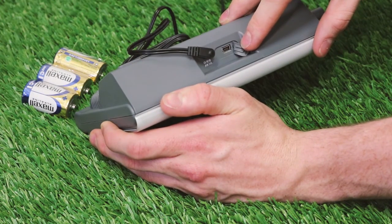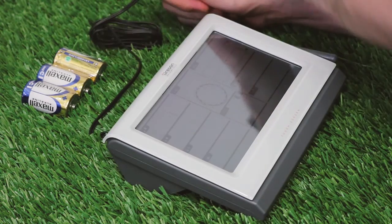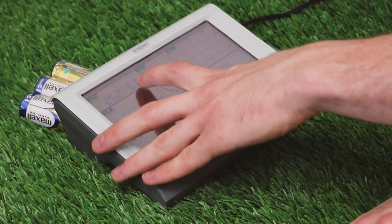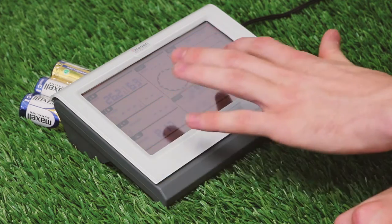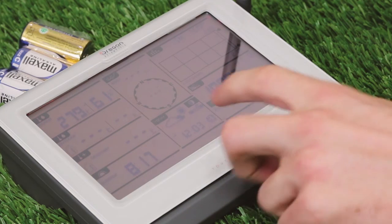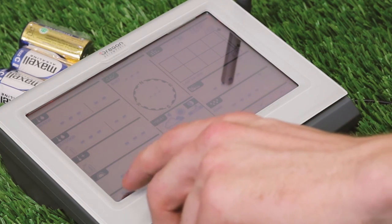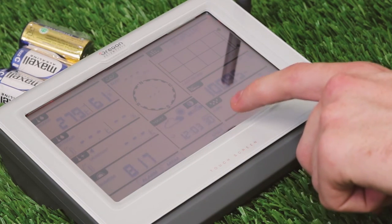This is where the mains adapter plugs in, and also where the USB plugs in if you'd like to download information from the main unit to your computer. Now that the unit has turned on, we can see indoor temperature in the top left is 26.2 degrees and humidity is 63% — those readings come from sensors inside the main unit. In the outdoor section there are no readings yet because we haven't synced. To sync: click today, then hold down set and unit at the same time, set it to channel 1 (the default broadcast channel of the transmitter), hit set, then tap anywhere else. It will now search channel 1 for outdoor sensors.